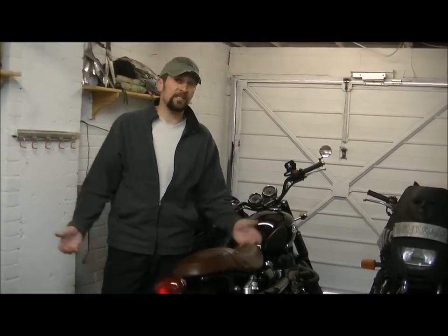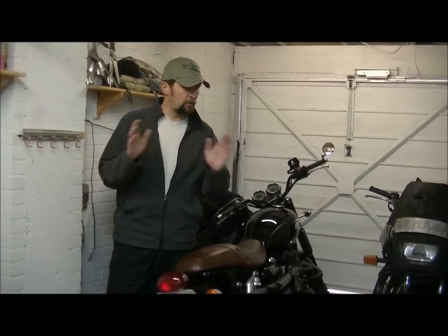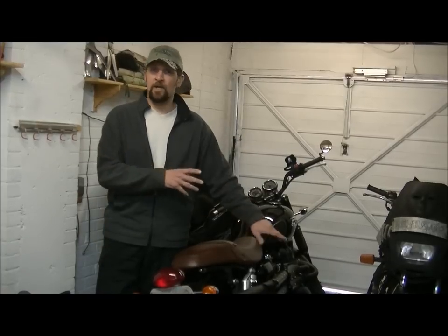So there we go — that was how to repack a baffle. It's ever so simple. Your baffle might be the parallel kind or whatever it is, but that's the simple principle: get that central tube out, get it repacked with loft insulation which is just as good as anything else. You can buy the proper wadding if you want. This has worked for me for about 25 years and it's never let me down. That stuff will still be in there going strong in about two or three years' time — then whip it out, another ten-minute job, repack it again. Hope that helped you out. Ride safe, take it easy, and we'll see you next time.